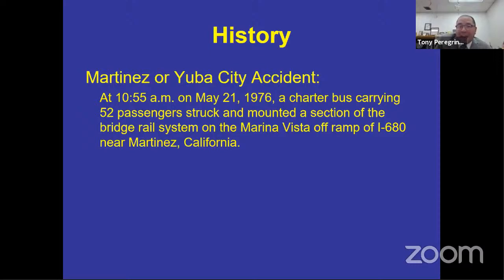For your buses now, 121 after April 1st, 1977, if it's a 121 compliant vehicle, the low air warning device has to come on at no lower than 60 PSI, and at all pressures below 60, it must stay on. So you only have a lower limit. You don't have an upper limit for your system today. So we're looking for 60, and all pressures below 60 is the requirement for your bus. This bus, light and buzzer between 75 and 55, it goes off. He doesn't know it's the low air